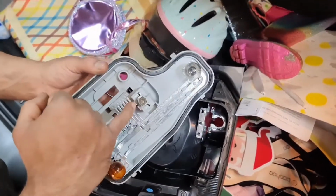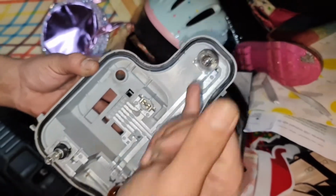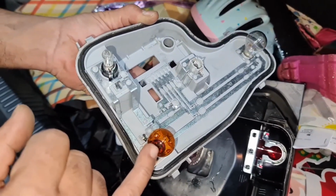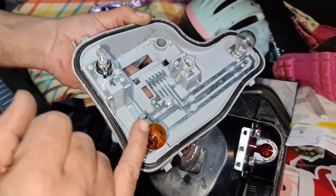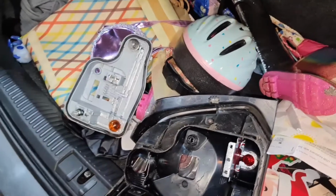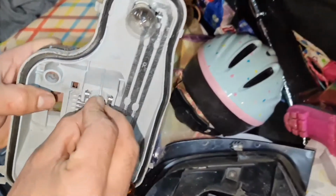Okay, now this is the bulb we're replacing. It's a 501 bulb. I've got the bulb already. If you did want to do the other bulbs as well, you can do that at the same time. And this is going to be a 434, I'm sure this is a 434. This is going to be a 3, I don't know, I'll put the numbers up in the description anyway. And that's a 382 bulb right there. So if I just put this on the side for the minute, got the bulb all ready. That's a 501 bulb. I'll slot that in.